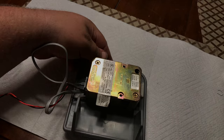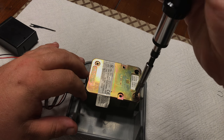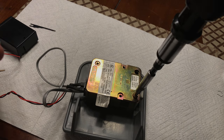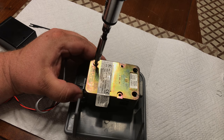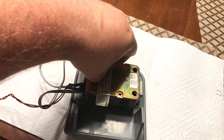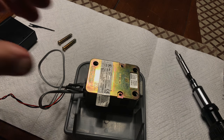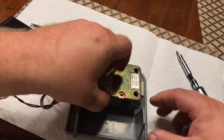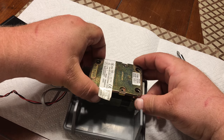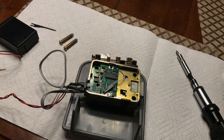I'm going to try to make this video a little shorter than my last one — that one turned out to be about 19 minutes long. To do this you do need the back cover off. The 3090, which is the lock that replaced this, has a reset box; this one did not. I do know they make a programming box for this but I've never seen one. This lock has features such as dual control and time delayed opening, but unless you have that programming box you can't change any of those features. With the 3090 you can enable those features just through programming.